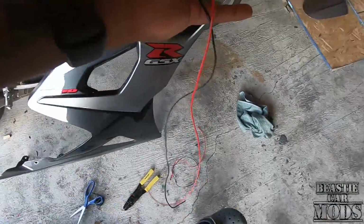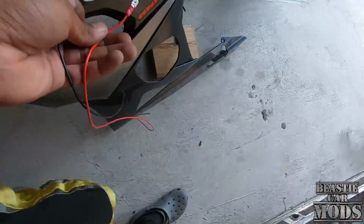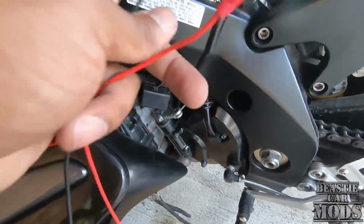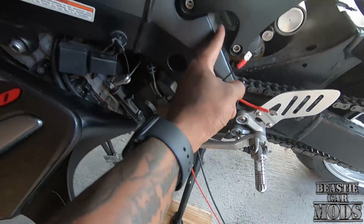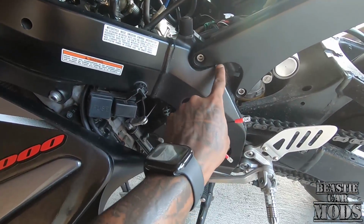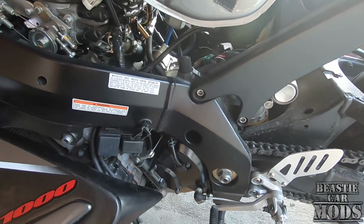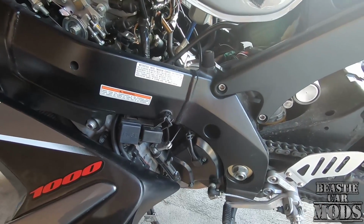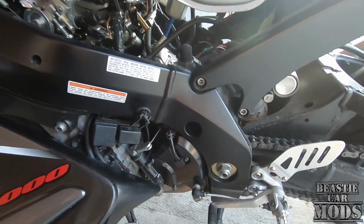And these are the ones for the other side over here. I just size them up, see how long I need them. These ones can connect, and they all gonna meet here in the middle. Wire everything up right here in the middle. Then we're gonna run everything right here to our toggle switch we're gonna pick right here. And the toggle switch, run to the battery. All right, I'm gonna go ahead and hook these quick connects up. Then I think I'm gonna start getting the toggle situated, getting the wires ran for the toggle.